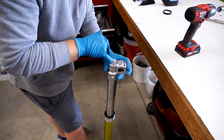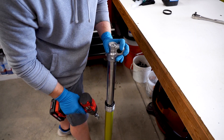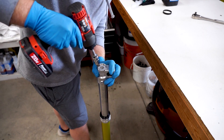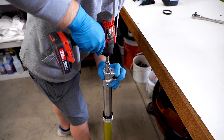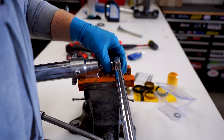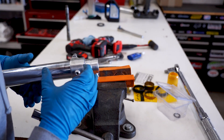We're ready to pull this thing out of the vise, slide up the tube, tighten down the cap, and seal this baby up. The torque spec for the fork cap is 22 foot-pounds. Also make sure you have some oil on that fork cap o-ring too. Now we can't forget about torquing the lower cap. Being that I don't have the holder tool, I'll show you a little workaround - put the fork cap on a rubber mat, or if you're a redneck like me just put it on the top of your shoe to protect that cap, then compress the fork down and hit it with the impact until it snugs up. Then we'll pop the fork back into the vise and the torque spec on this is 40 foot-pounds.